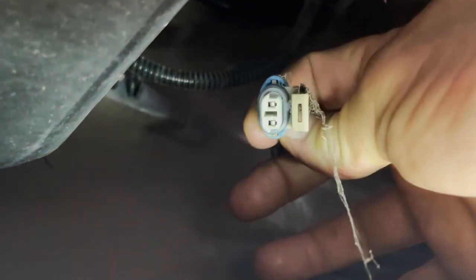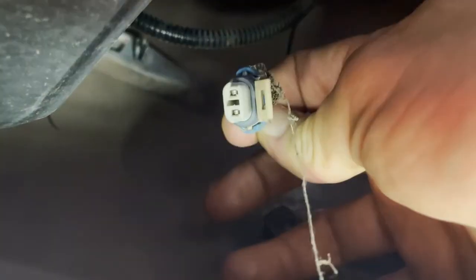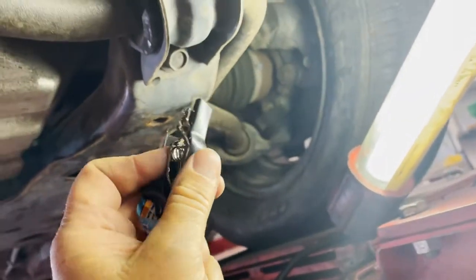This is the horn connector right here. We want to disconnect the horn connector and verify we have power going to it. Mr. Lear is going to hit the horn and I'm going to verify we have power. If we didn't know it was a loose connection, we'd say the relay tests good — now let's see if there's power going to our horn. We'll use a test light. Hook it up to a good ground, like a body bolt, then install the probe into the connector.